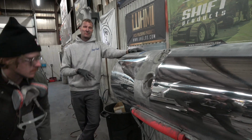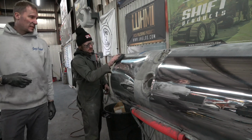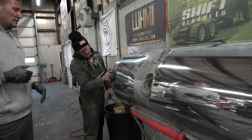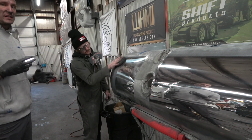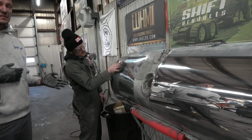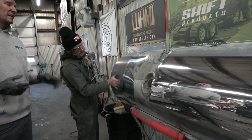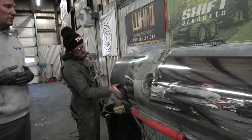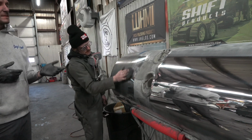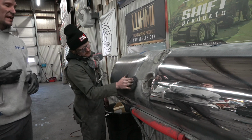But with our yellow and brown, make sure it wasn't a buff that you were doing yellow and green in. Make sure you rake it out really good because you want that yellow buff to be really nice and soft. If the yellow buff isn't soft, it's going to scratch in this stage too, much like the orange and brown did. As you guys know, I don't rake my cut buffs except for when we get into this show level. So orange and brown, I didn't rake it out because all we were doing was cutting through all the pigtails and all the sanding. But now that we're through all that, we want to start softening those hash marks up.